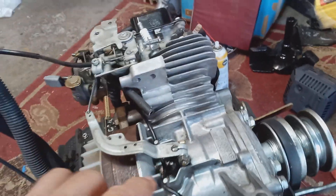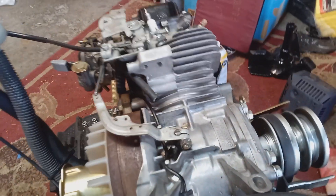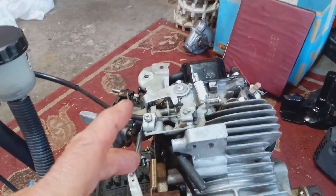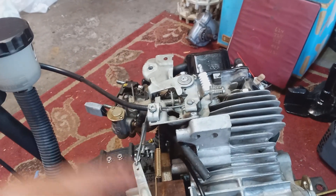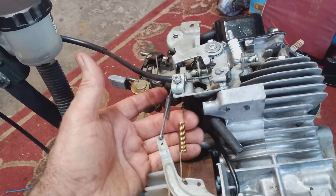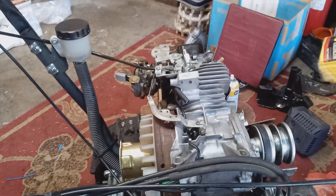It's pretty easy, but you'll want to take the fuel tank off in most cases so you can see better. I took the fuel tank off because I had the racing problem and couldn't figure it out, so I went back to square one and started all over. As I was taking the coil cover off, I noticed that this spring was stuck between the coil cover and the body of the engine. That was the whole problem.